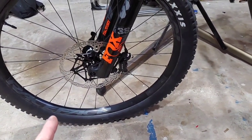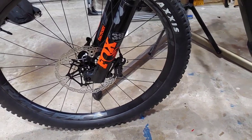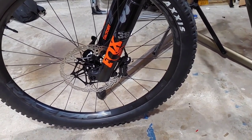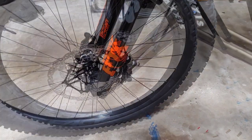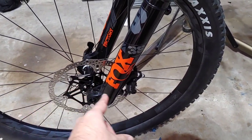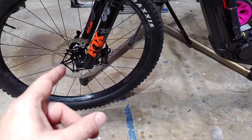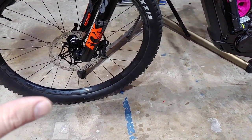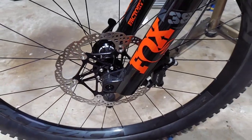These came from Chain Reaction, which is a company in the UK, and it only took about three days for them to get here. The SRAM Centerlines are relatively inexpensive and these were on sale, so these were only about ten dollars more per rotor — it just made sense. I was really hoping they'd fit because I know these rivets would make contact with the old Fox 36, but they don't anymore because they're definitely thinner. On the front there's plenty of clearance, so it's a direct drop-in for the 220 millimeter setup. If you're running a 200mm up front it might make contact because you don't have as much material and the rivets are closer to the edge.